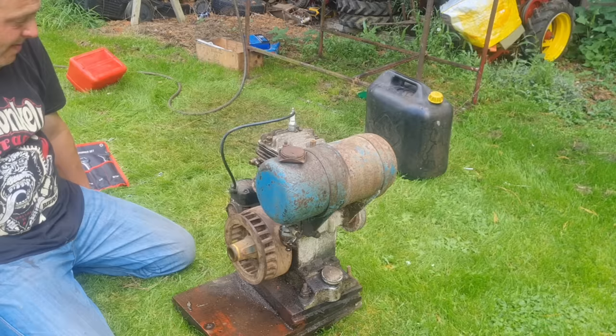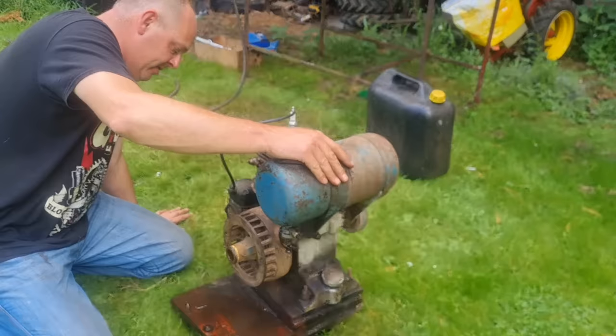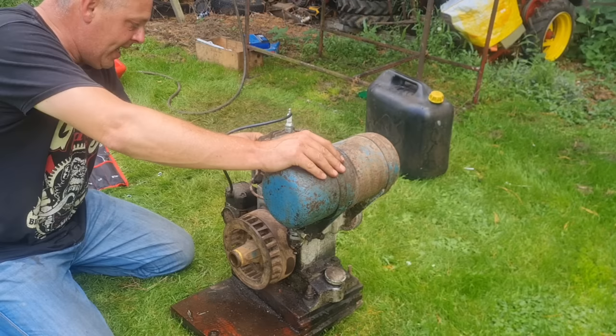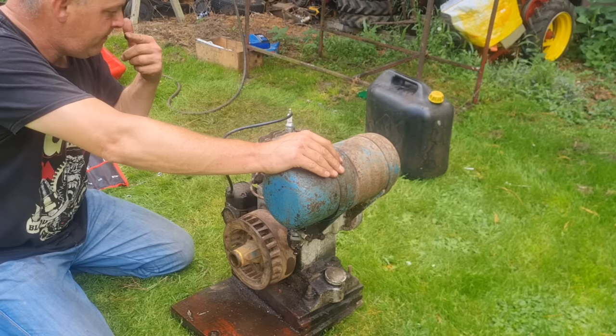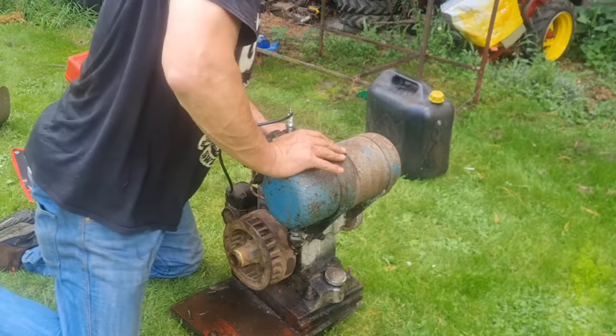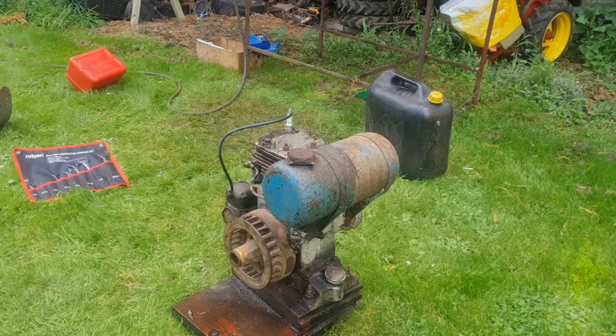Well, there you go. We're going to have to call this video a day, guys. Sorry it's so long and drawn out for a non-eventful end. But that's my videos for you. I leave everything in. The faults, the cock-ups and everything. I cannot see why this little thing has not started. I really can't. It should do. We've wiped all the oil out of the cylinder when I had the head off. We know it's sparking at the right time. But that's about all we do know.